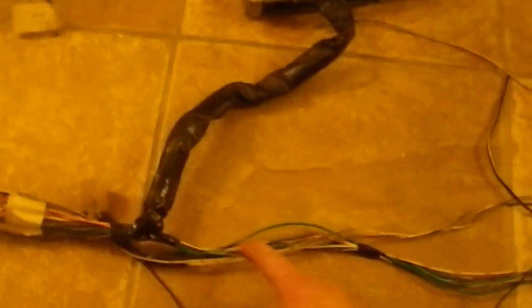The main portion of this video is about what I did to separate all the fuel injection components off of this cal harness. There are lots of ways to do this and I'm not saying my way was the best, but it should work. What I did first is I looked at the connector that goes into the ECU, and before that I took the whole harness apart — I removed all the tape and traced each wire to find out where it led.